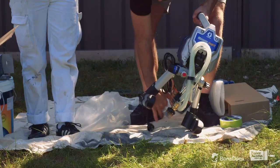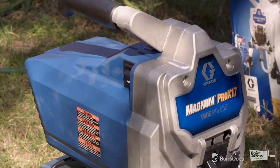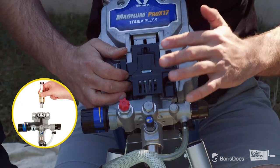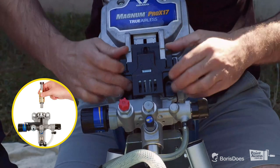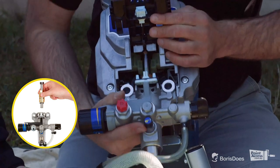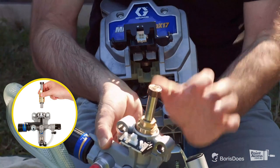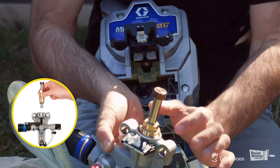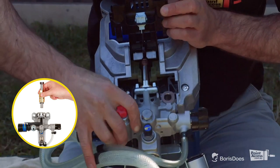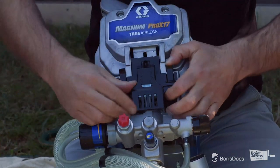It's pretty compact and it's on a stand. A pretty cool feature with the Pro X17 and Pro X19 — if something goes wrong with the pump when it's out of warranty, it's very easy to change right on the side. You just pull this cover up, take the whole mechanism out — it's very simple. That's the actual pump. You just unscrew the boot and you can easily put a new one in and put it all back together. That's it, it's all locked.